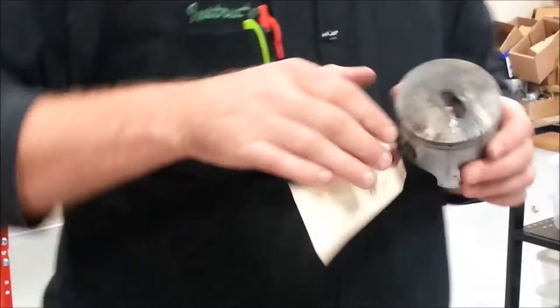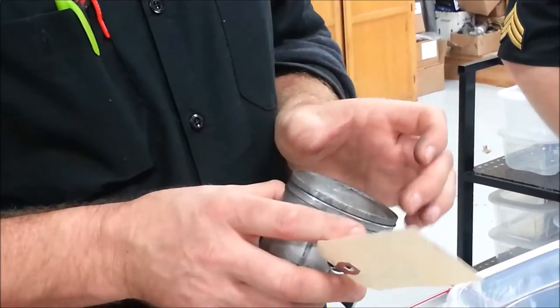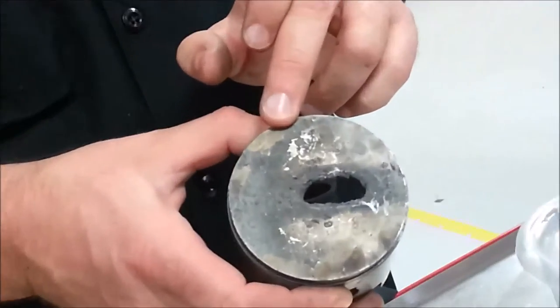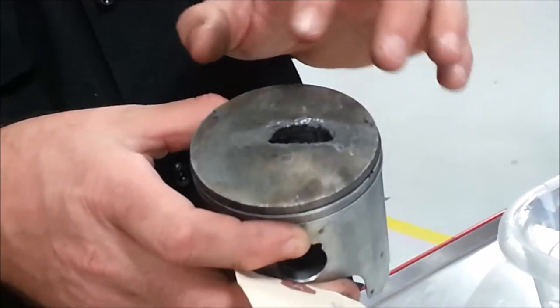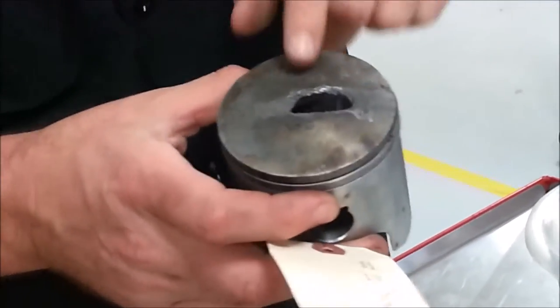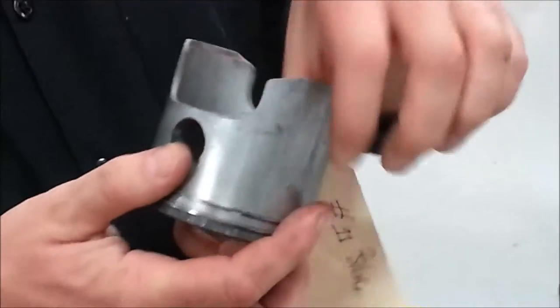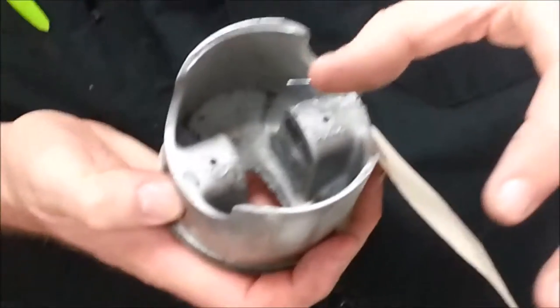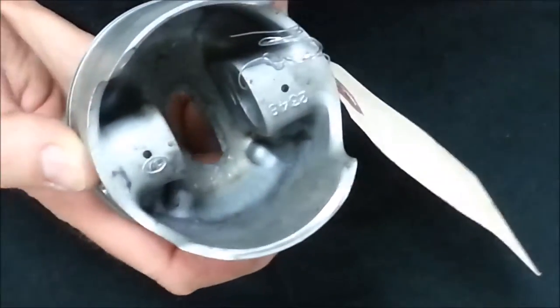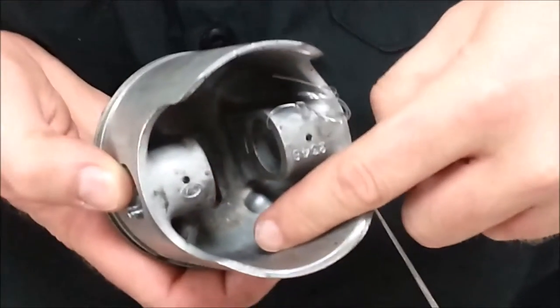We saw this in the video too where they talked about it having an ignition problem and basically just melting that piston away. Can you actually see the splatter of all the aluminum on top of the piston? It's a thick coating — that actually went pretty quick. The fact that this is pretty wide means this probably happened under full throttle — just completely brapped on the pipe, smeared it off, and finally poked through. If you feel inside here, you can actually see where the aluminum has sprayed onto the skirt wall and attached. If it's sprayed there, where else is it? It's everywhere — the crank, the cylinder, the bearings, everything.